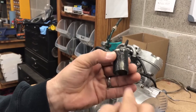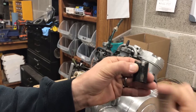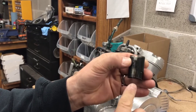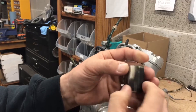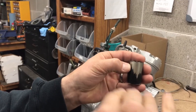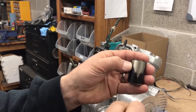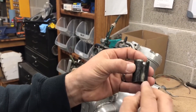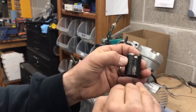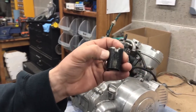This cutout area has got to be facing back towards the air filters. If it's facing the other way, it completely closes off the air from the motor at idle and suffocates the engine. So the air cutout in the slide has to be oriented this way so you get the proper amount of airflow into the venturi of the carburetor.